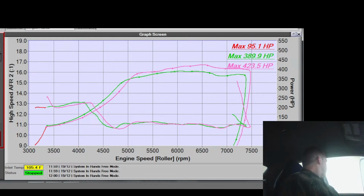I've got to wiggle it at 55 as well. I still have a lot of advance there, so maybe I just do a step change. We'll go 25 degrees to 15 degrees on the intake timing and see what happens. Because that definitely increased the power, but still that same wiggle. We've got more climb now, so that's good.